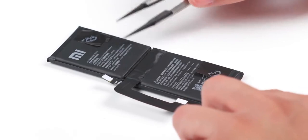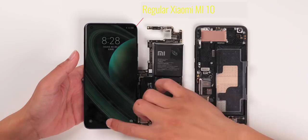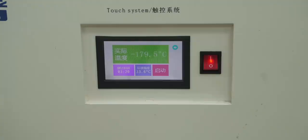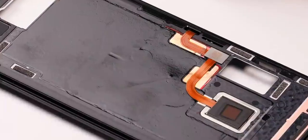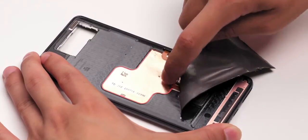The two battery specs are separated since the device supports 120W wired fast charging. We placed the screen of the regular Mi 10 onto the Ultra and ran a boot test — no problem with the display or touch, though it may not support the 120Hz refresh rate. For display teardown, we try something different: placing the display inside the freezer set at minus 180 degrees for 3 minutes. Upon opening, the middle frame, inner display, and outer display separated all at once. Due to sensor positioning differences on the motherboard, the display punch-hole location has been adjusted. Between the screen and the middle frame there is a large piece of graphite sticker, and below it is the in-screen fingerprint module. Tearing off the sticker reveals a large vapor chamber plate — the thermal dissipation material is really sufficient.